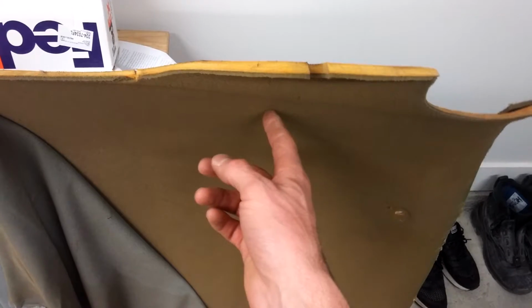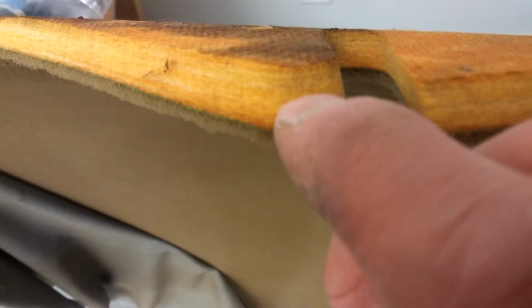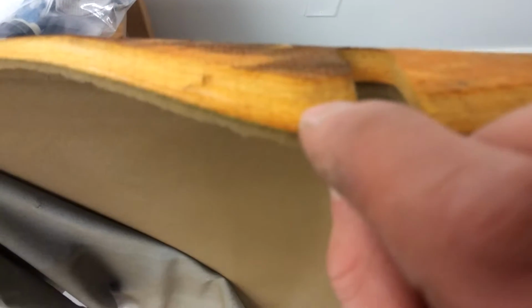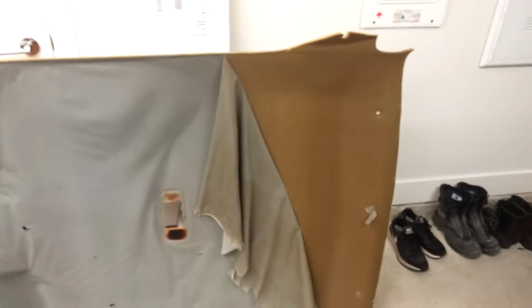And it gouges. It'll put deep scores in this fabric. Because when you grind off this foam, it's just this soft fiberglass. You see all these layers of fiberglass in there? It's really soft, and there's just a very, very thin coating of glue on top. So as you're scraping it off, you're going to score the board, and all those imperfections are going to show.